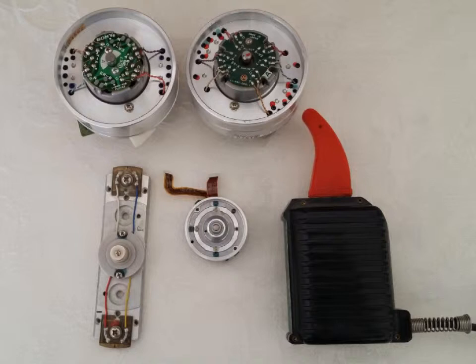There are a lot of specifications online. You can clean them using either a special cloth or a special chamois, but my personal preference is to use a cloth material and clean them by the sides of the video head itself. You want to clean the side of the video heads and lightly spin it with some material to pick up the debris. You don't want to press hard, you don't want to press up and down — just slightly against the side.